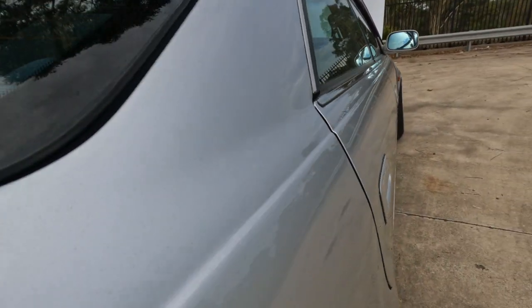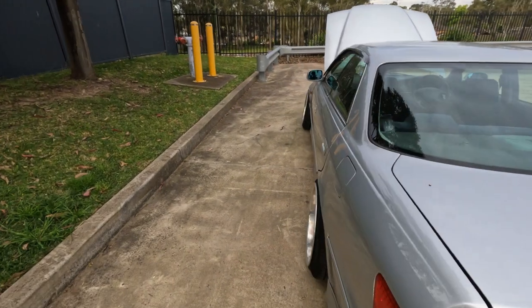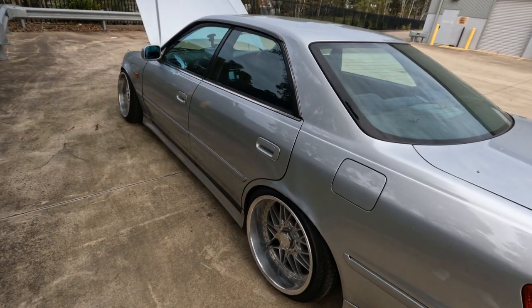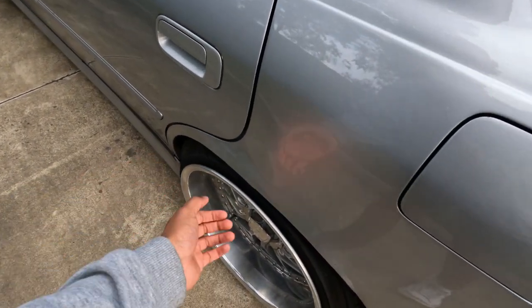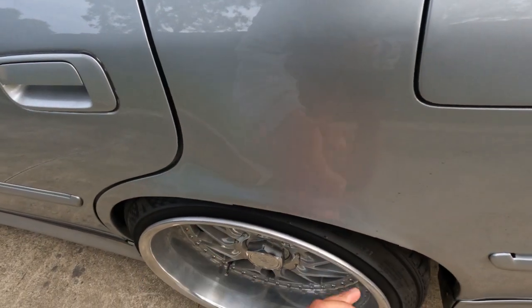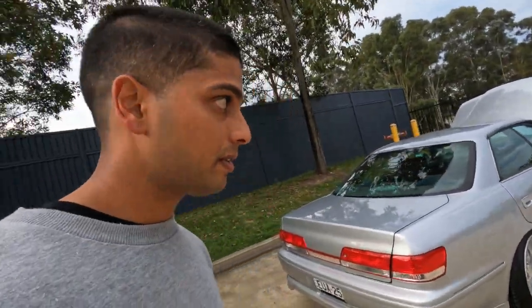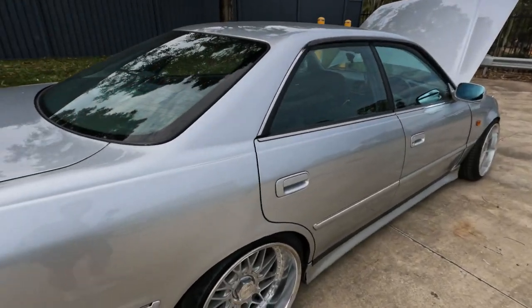It is a little bit cracked and slightly mangled on the other side. I tried everything to get these guards to fit — I used a guard roller, modified the guard roller, then used a phone book, then the last resort was a piece of timber to get some leverage and push it out. Traditionally in Japan they actually hammer it from the inside, or cut the actual metal and hammer it out and smoothen it. The finish is immaculate if you do it that way. Unfortunately I got the wheels the day I was sending the car off for paint. Pro tip: before you send your car off for paint, make your wheels fit, bang them out, and get your panel beater to smoothen it out and make it look fresh.